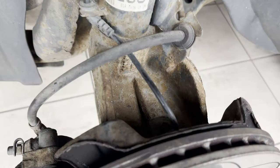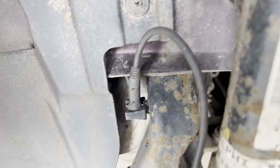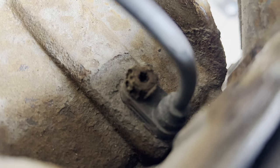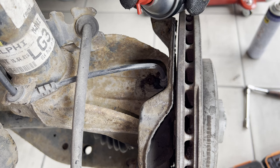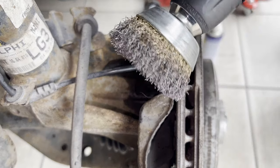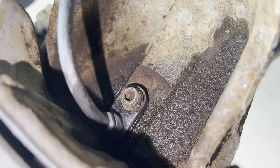This is the culprit of our problem — here's the ABS sensor. It runs all the way up here and down into the engine bay. Let's try and remove this bad boy. It's pretty corroded down here, so let's hope we get it out easily. It's all pretty crusty in here, so we're first gonna clean it with some brake cleaner and this little brush. Then we're gonna spray some penetrating oil on it, and we're also gonna get a wire wheel in here. I think we're ready to tackle this corroded bolt.